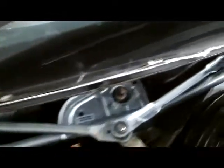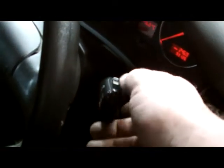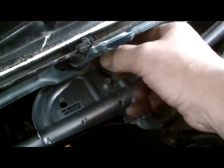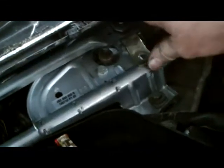So how do you zero the motor? Because if the wiper's in the wrong position, you don't zero the motor. Now put the key back in, switch on, put the wiper motor up. Let the motor work. Switch it off here — motor switch is off. Take out the key. Now we know the motor is in the down position, and then we can put the lever here.